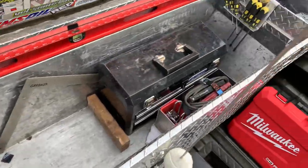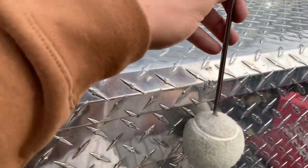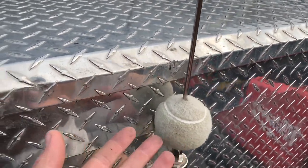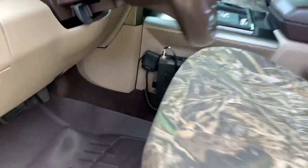I got the tennis ball on here — in case you don't know, the antenna is stainless steel and the toolbox is aluminum, so when it hits it will wear out the toolbox. I didn't like the look of the tennis ball, I tried avoiding it for as long as I could, and I eventually just had to put one on.